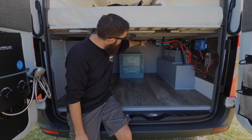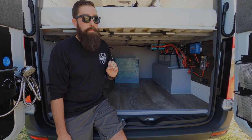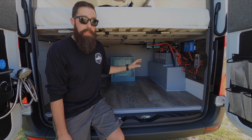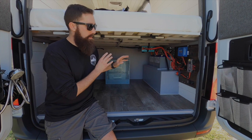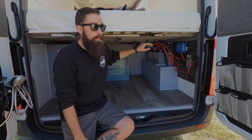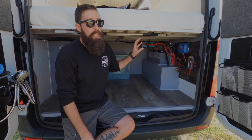The Renogy 2000 watt inverter is mounted up underneath the bed right there. We have two 100 amp hour Battle Born lithium batteries. I cannot recommend Battle Born enough — we used them in our last van for the full year, we have a 10 year warranty on them, and we are not sponsored by them. The support through them has been amazing, the batteries themselves have been amazing, and the power you get out of them plus the weight savings — lithium versus AGM — if you're thinking about building a van I cannot recommend saving up enough money to go with lithium enough. From the batteries, we have the Victron BMV 712 Bluetooth battery monitor. It monitors your input and output and will show you exactly how much voltage anything is using — if you have your fridge going, if you have lights going, you can see the amp draw. That has really been nice for keeping an eye on everything with your batteries.